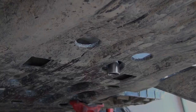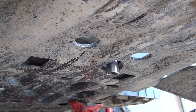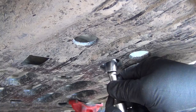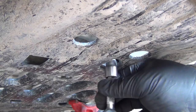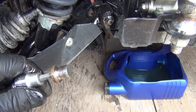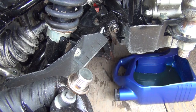That plug can be pretty tight, so you want to make sure your six millimeter Allen head socket is on there good so you don't strip it, and hopefully she comes out not too bad. You must really torque on them from the factory. The stuff looks pretty clean actually, which is good. You're going to want to inspect that little metal sealing gasket on the plug. If there's any doubt, change it — this one looks okay though. Blew it off and put some anti-seize compound on there again.